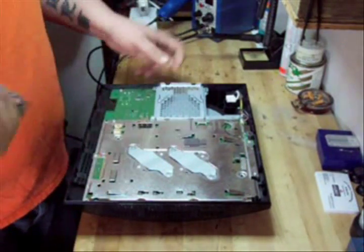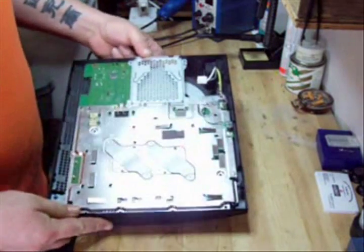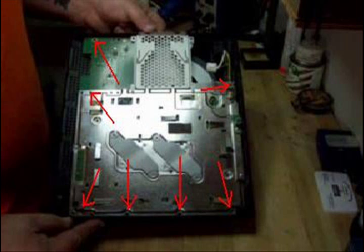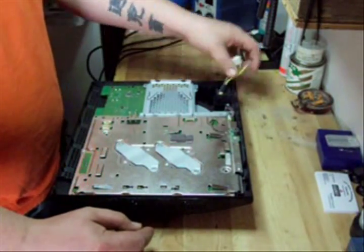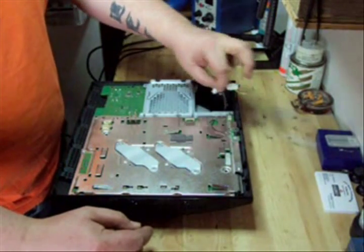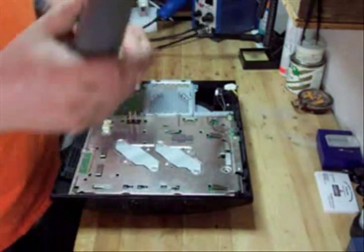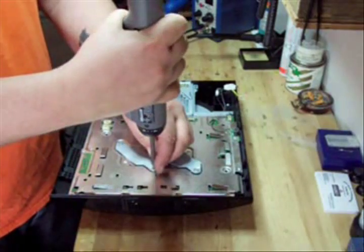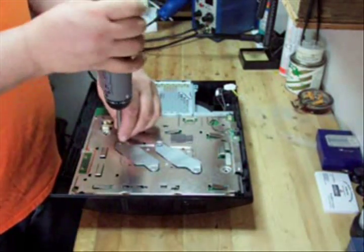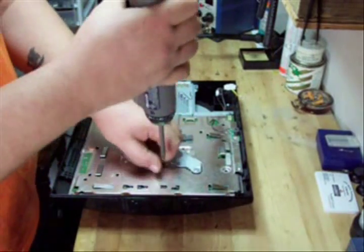I had a request for this and it's taken me a few days to get to it but I told you I would do it. There are seven screws that are necessary to be removed including the power supply ground wire. Once you have those seven screws out you're going to take the power supply plug and put that to the side. There's a fan plug right here — you're going to remove the fan plug. The fan actually stays in the lower half of the case on this one. This is where you're having the problem where you can't get the board out — you removed all the screws but you didn't remove these clamp screws. You're going to take out the four screws on the clamps and yes, you're going to have to replace your heat sink compound.